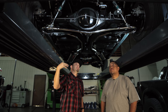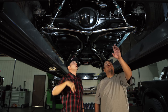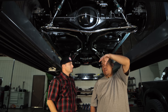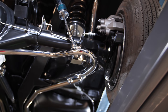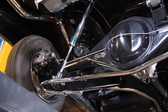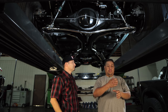These look like regular shocks, but you're shooting hydraulic fluid through that? No — this is a shock, an actual shock. But then this is the hydraulic cylinder, and we do a coil-over. Before all you off-road guys had a coil-over, we did it first. The coil goes over everything and keeps it from kicking out when the car is jumping around in the back. So you've got the hydraulic cylinder bolted right to the arm, on a power ball which is a pivot, and it lets it articulate and do whatever it wants to do.